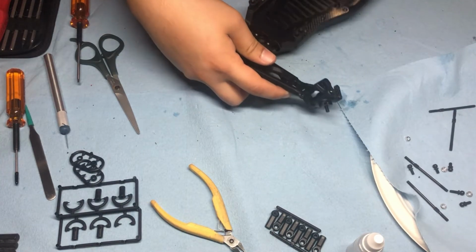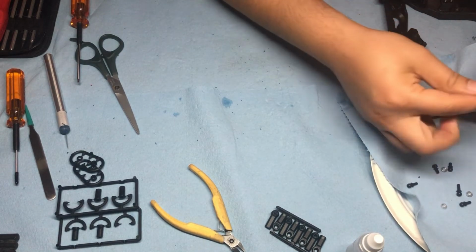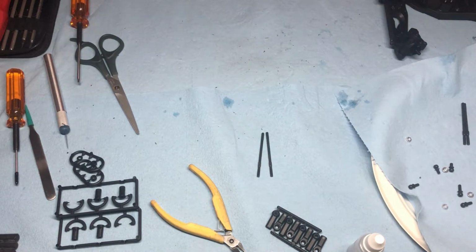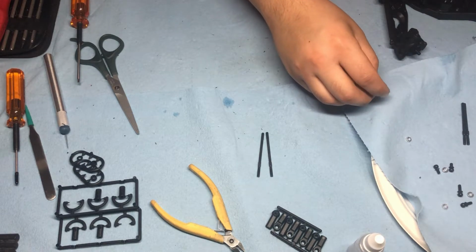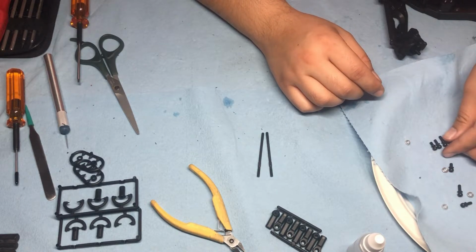Now we can set the chassis aside, and we can assemble the camber links and steering links. So it looks like all of the turnbuckles are the same length, so I'm going to grab 2. And for the camber links, which they call roll center links, we're going to need a 6mm threaded ball stud and an 8mm threaded ball stud. And one thing that surprises me is that they don't have that measuring thing on the side of the manual, so you can just line them up,